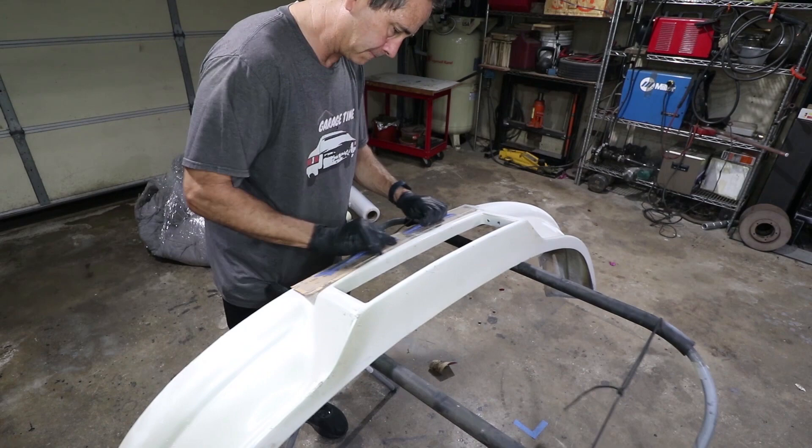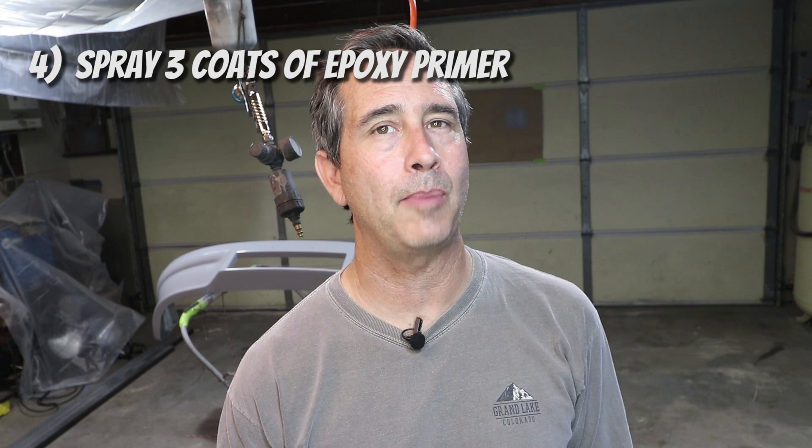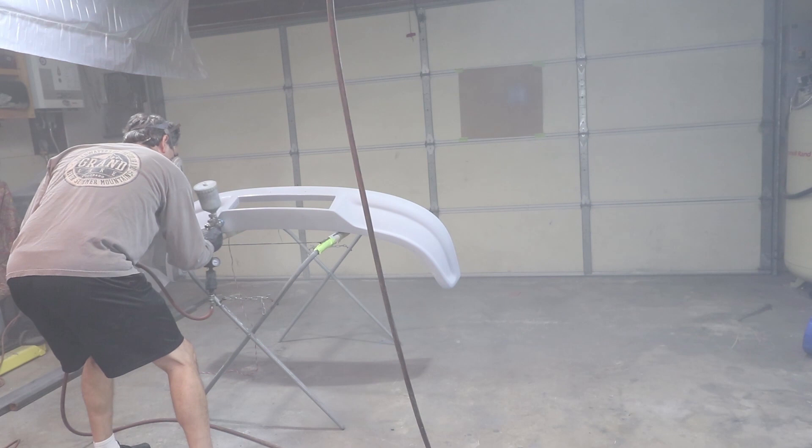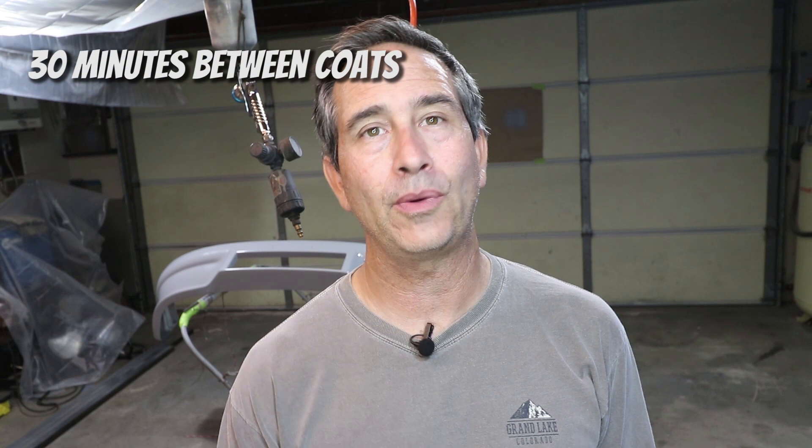After the paint was roughed up, I did three coats of epoxy primer. Don't hurry the epoxy primer — you've got to let it dry between coats. With SPI, you can't put it on too heavy. In addition to letting it dry between coats, once you've got the third coat on there, give it some time to dry and shrink, because the stuff is going to shrink over time.